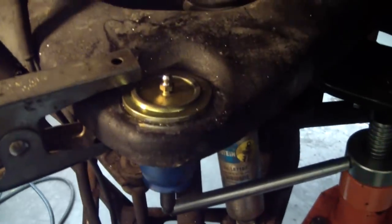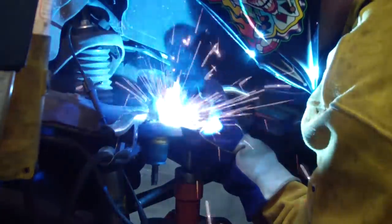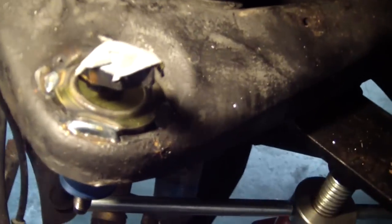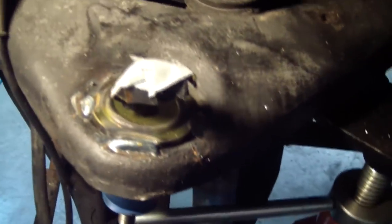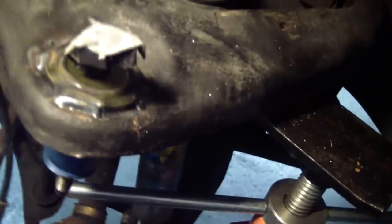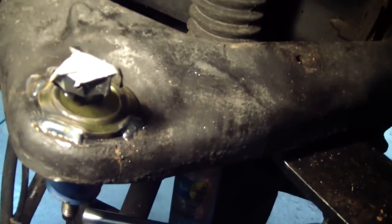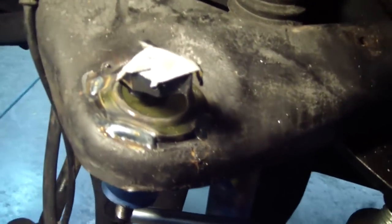Another solution might be a slightly oversized ball joint or a new control arm. Here's the ball joint tacked in there — you can see we had the zerk in and covered so crap didn't get in there. Actually when we replaced the other side a couple months ago, you noticed it was welded in — possibly had the same problem over there. We put a Moog ball joint in over there though and it's holding fine without weld.